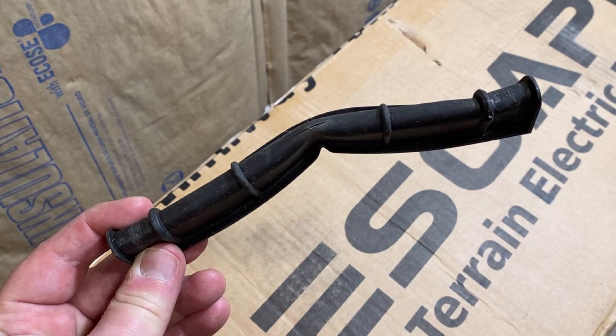Look at these classic handlebars. The grips are vinyl leather-look comfort grips, with a half grip on the right side to accommodate the twist throttle. The shifters I call Mickey Mouse shifters — they're cheap but work well with twist throttles. Brakes are thankfully hydraulic; this is almost 90 pounds so it needs help stopping. Next to the full comfort grip on the left is the computer control, easy thumb reach and simple, plus a bike bell. The computer display is a large monochrome backlit screen centered on the top bar. It shows battery level, which of the five pedal assist modes the bike is in, a speedo, trip meter, ride time, and odometer. The speedometer can be switched between real-time, average, or max. There's also a headlamp indicator for the bright headlight and a taillight that flashes while braking. Cables are cleanly routed and well-managed, and those mount points on the head tube are for the available front rack.